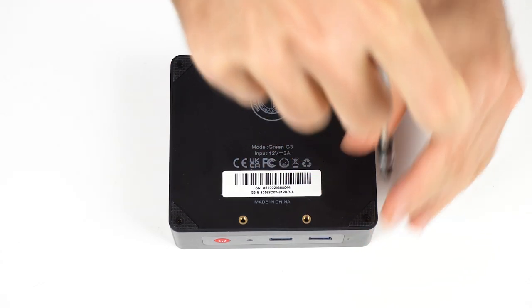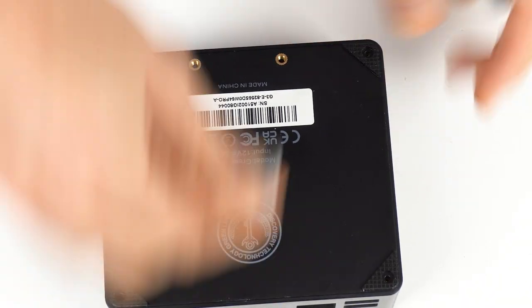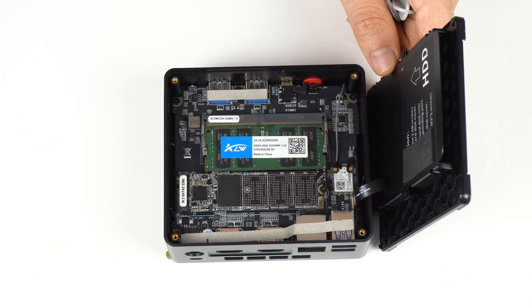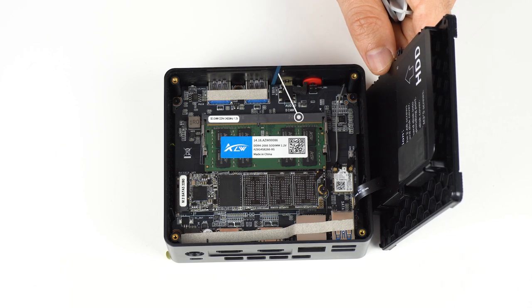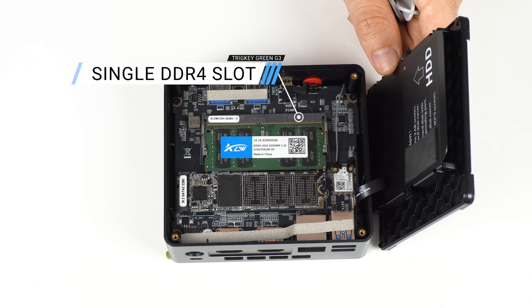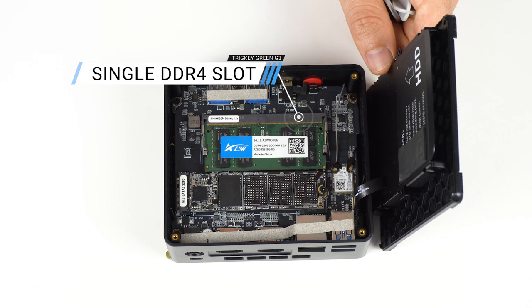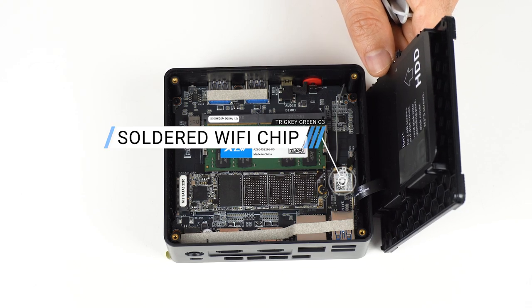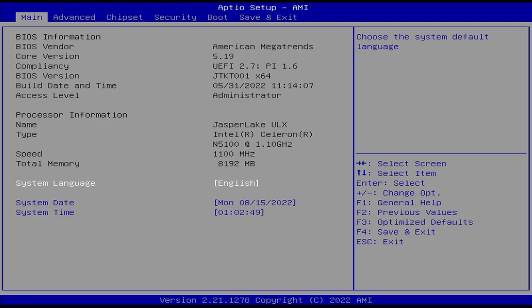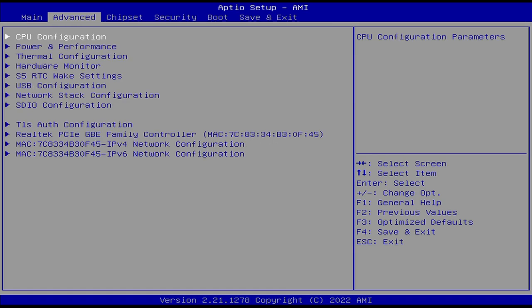Once unscrewed, you'll need to use something to pop open the lid. We've got the M.2 SATA SSD, and here we have the common mistake — this mini only has a single DDR4 stick, which unfortunately reduces graphics performance. Ideally, soldered-on dual channel RAM would have been the way to go. The included BIOS has a bunch of options, but for a locked CPU, there's nothing too interesting.